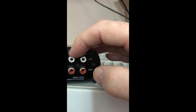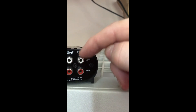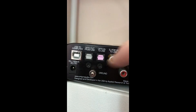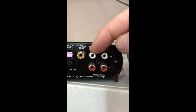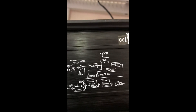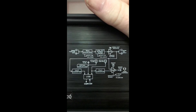This is your preamp line out. And this is your phono or line in — so basically if you hook your phonograph or turntable to here, it's got a ground connection over there. You connect your ground there, and then this goes in, there's a preamp, and this is your preamp out. Or if you connect your tape deck to here, then this would be your tape deck out. Very versatile thing. And if it all gets confusing trying to figure it out, they put a block diagram schematic of how it's wired so you can figure it out.